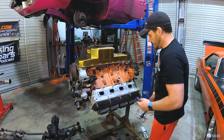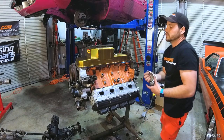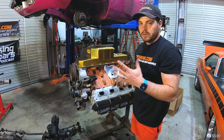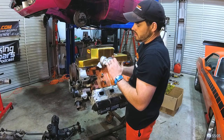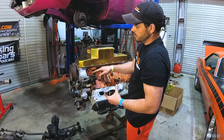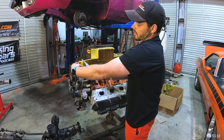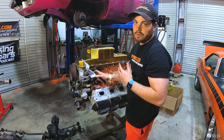So we're done with that. Now let's talk about the bracket itself — the oil filter relocation. If you are putting this in a D-150, like our low-buck Hemi truck, or a 10-grill '73 through '93, you could just simply bolt it on as-is. It has the O-rings and three bolts. Put a little blue thread locker on there so it doesn't vibrate off, bolt it in, and run your oil filter like this — you'll clear your cross member in those trucks. Nothing else is really required.